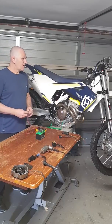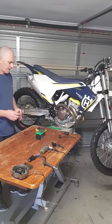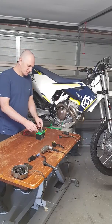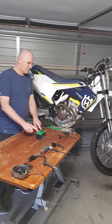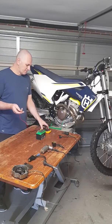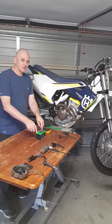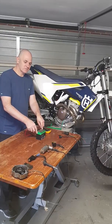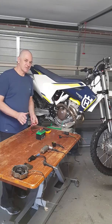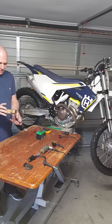The third scenario is the motorcycle is draining the battery whilst you're riding it. The way to test this is: remove your battery, make sure it's charged above 12 volts, put it back into the bike, and start the motorcycle. Get a test meter and put it on the positive and negative whilst the bike is running. You should realistically see around 13.6 volts whilst the bike is running. If you're not seeing this and it's actually draining the battery, it's most likely that there is a problem with your stator or alternator.